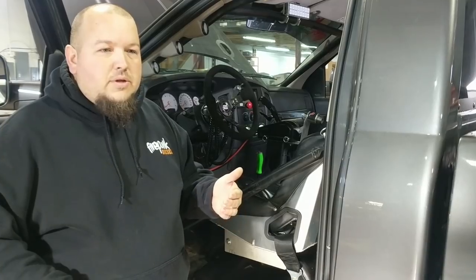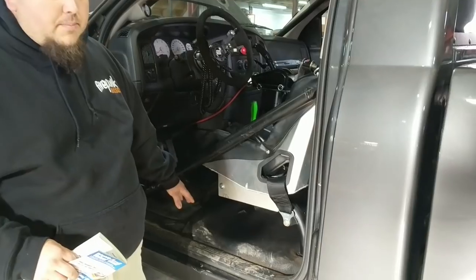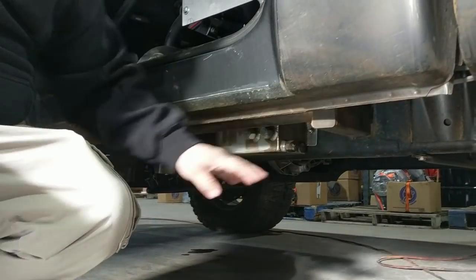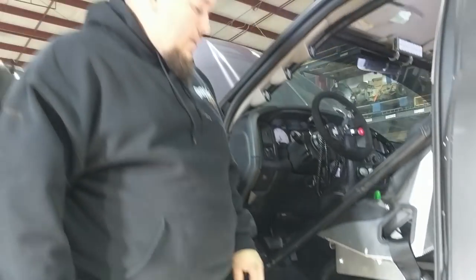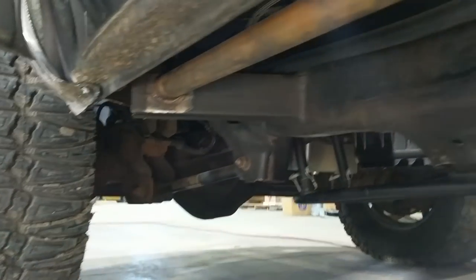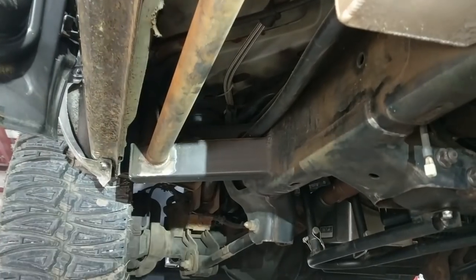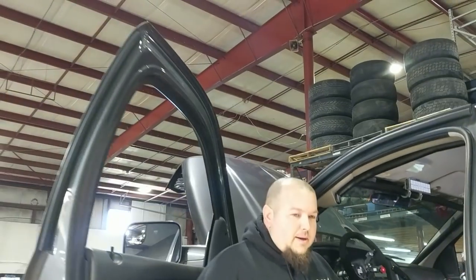Keep in mind that a lot of NHRA rules weren't designed with our big, heavy 8,000-pound trucks in mind, so anytime there's something extra you can do for safety, I encourage you to do it. There's a bar underneath the cab called a rocker bar — it runs from the rear outrigger to the front outrigger and gives you extra side protection in a side-impact accident. The outrigger construction is two-by-three tubing welded to the frame, with the bar running down to it.